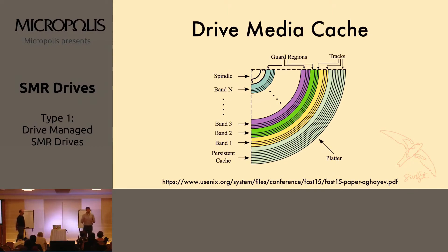And it is the media cache. This image is pulled from the Skylight paper — there's a link at the bottom. There was a paper presented earlier this year at the FAST conference where they took some of these drives, literally cut a hole in them, sealed it off again, and then watched what the drive heads were actually doing under various workloads. It's a great source of reference for actual limitations and constraints of the drives, and in our own testing we've confirmed a lot of this experientially.